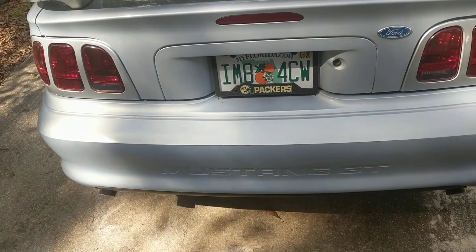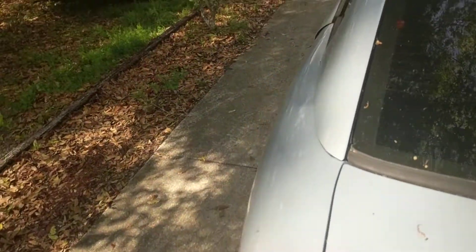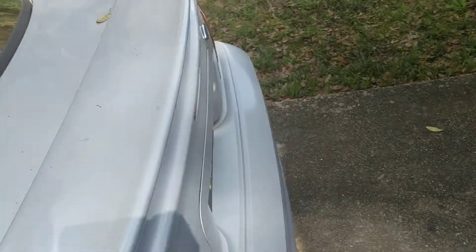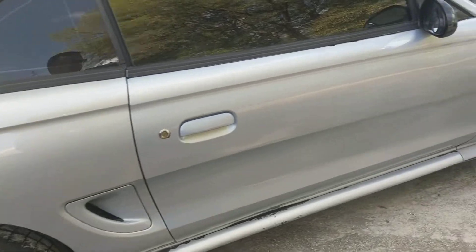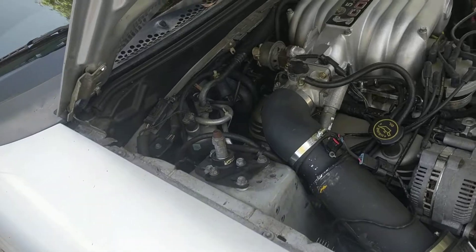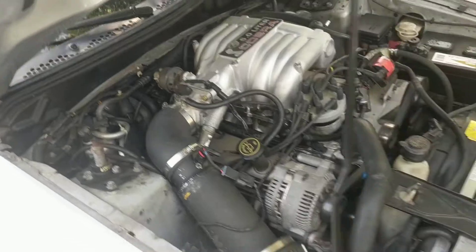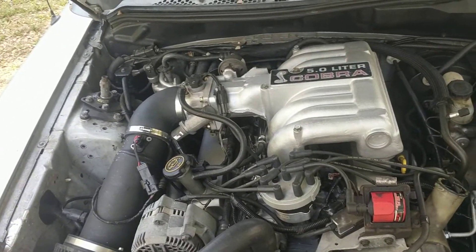Two and a half inch mufflers and tailpipes. I think it's idling around 900 or so. I had a heck of a time getting it running because the idle was all messed up. Then I realized in the tune I still had the idle speed numbers loaded for the 94 GT with the goofy intake on it. So I put the fox body tune in there and it fired right up — idle's good now, runs pretty good. I'm gonna get it on the dyno sometime.